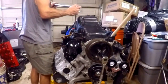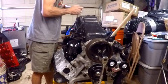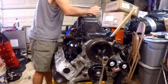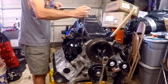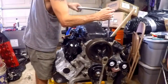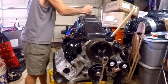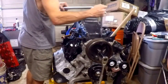There's no RTV on this sealing surface. Somehow it looked like someone used RTV before, which made it quite a chore to clean up the pan — I think there's been some significant work done on this block previously, so I'm not surprised. We didn't put any RTV before re-installing it. Should be a good seal as is — we have a rubber gasket, and in our case it's all brand new so it should hold well. If it were to start seeping, you can just come back and torque these bolts just a little bit and it should create a good seal.